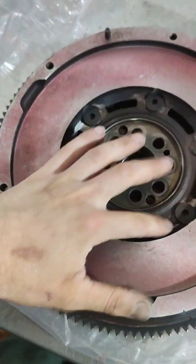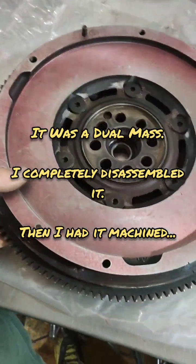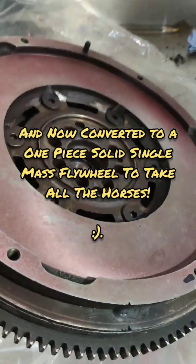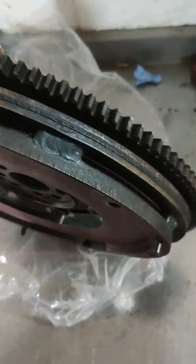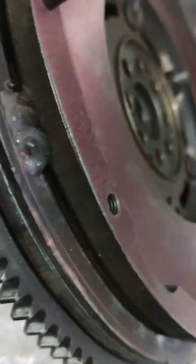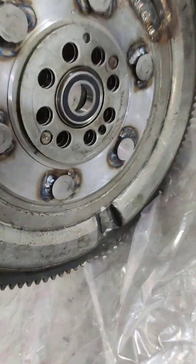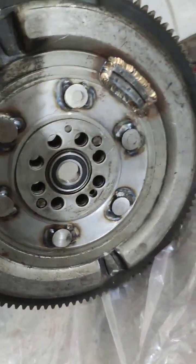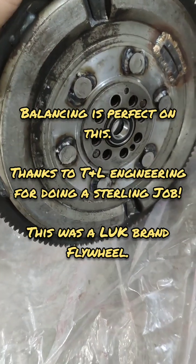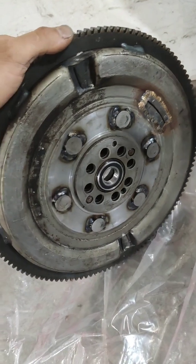This flywheel was actually a dual mass flywheel which I have had changed and converted. I had it all machined, had the inner springs taken out and everything. It's been not only welded but it's been shimmed in the centre and bolted. I'm going to put a new bearing in — that's not in the old way. All balanced up to less than 0.5 of a gram at some certain speed. I've got a spec sheet for it. But this is basically better than OEM.